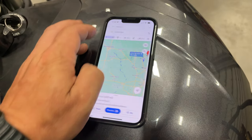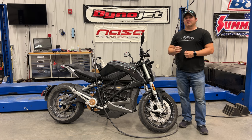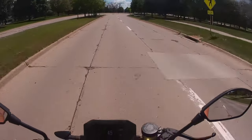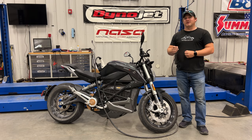If I was riding an EV, it'd be great because it would extend my range and give me a route that makes sense for an electric vehicle. So now the mode I use most for commuting has the maximum amount of neutral and regenerative braking. However, having all that neutral regenerative braking causes another issue: the cruise control is great in sport mode, but the minute you deactivate it under eco mode or another high-neutral-braking mode, the bike just starts to decelerate very quickly. It's very uncomfortable to use it that way.